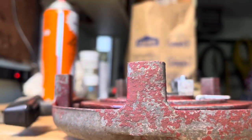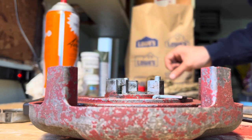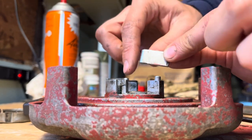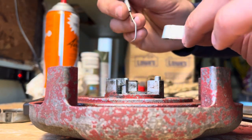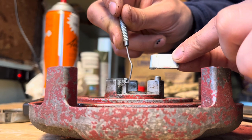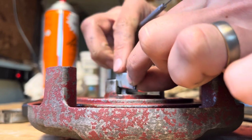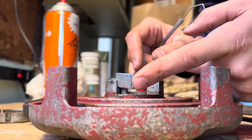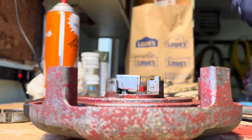If you do pull your pull cord apart, just make sure that these little metal flaps that protrude out when you pull the pull cord — which end up spinning the crankshaft — when you put them back in, there's a little tab on this spring. Make sure these go behind that tab so that when they come out the spring springs them back in, because you don't want to keep those out or they'll end up clashing when the motor's running.